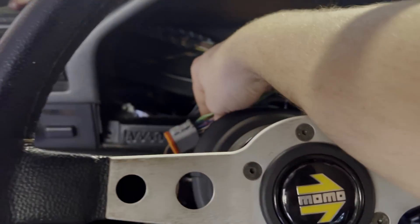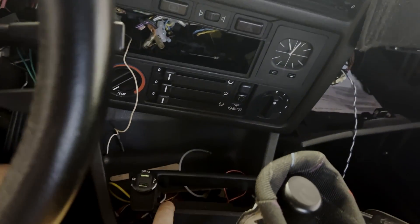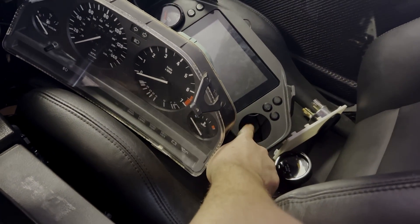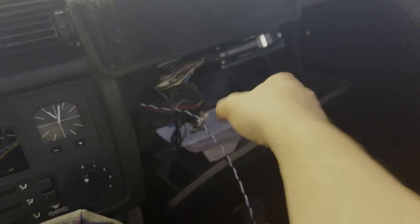Update two: a fairly considerable amount of time has passed, and I have pinned the rest of the chassis-side Deutsch connector. I probed the wires going to the fuel pump and sender — and the other fuel sender, which apparently these cars have; I probably should have looked that up beforehand. I've got the CAN bus wiring run through the dash. I still have to route the wires that were previously in the console back up through the dash and into the main cavity for the AFR gauge, connect my ground wire, and then pin the CAN bus wire into the back of the Megasquirt ECU. Then we should be good for a quick test run.